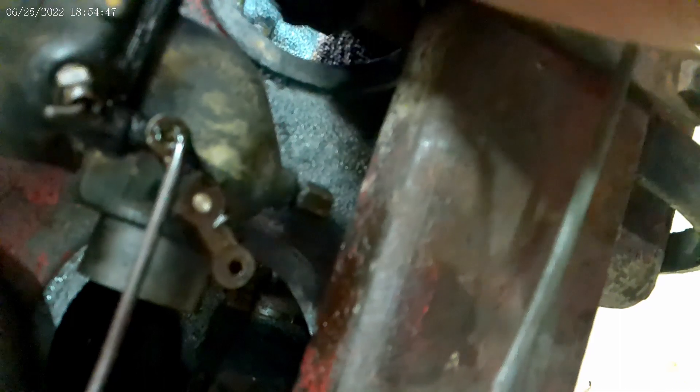The main bearings over here got some rust on it in the front. And you look at the crankshaft here — the stuff wipes off mainly so it's not horrible, but it's not ideal. Then you look at your connecting rod here and it's pretty furry. It'll have to come out and get cleaned up.